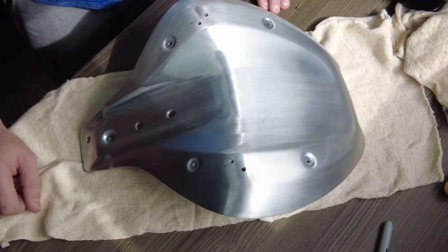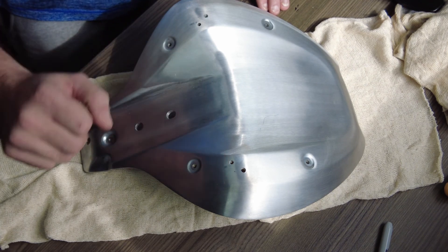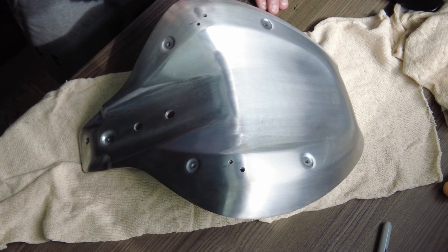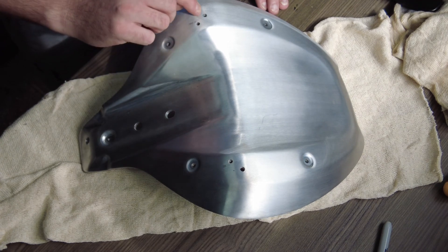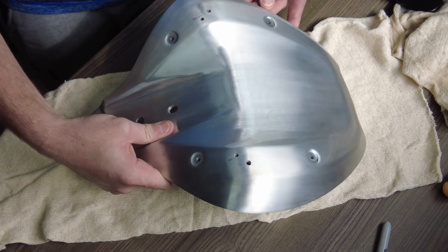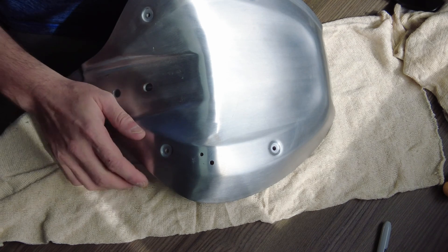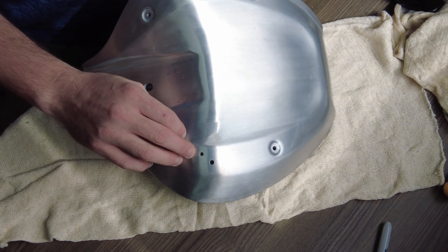If you take a closer look at the bottom of the aluminium seat pan, at the very bottom most part when it's mounted, you'll see there are two holes which I'm assuming are drain holes. These holes sit just a little bit too far forward at the radius on the bottom of the pan for where I'd like to put my lights, so I've already drilled two 5mm holes just aft of the two pre-existing holes, pretty much on the extreme bottom radius of the seat pan, so when you're looking from underneath the lights are right on the bottom and pointing straight back.